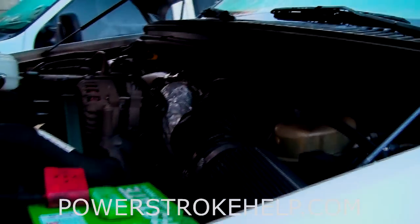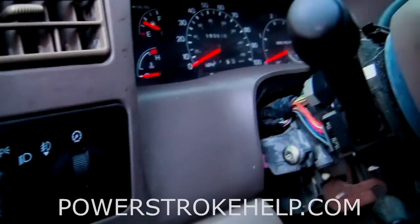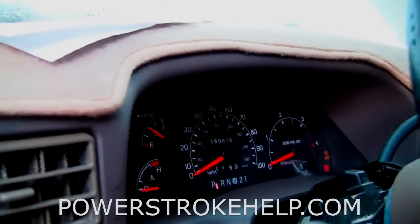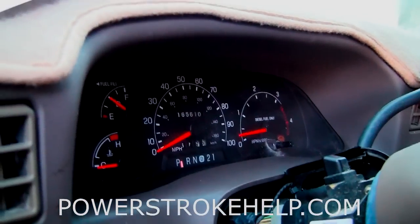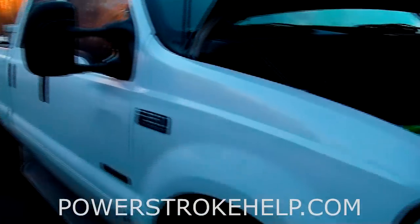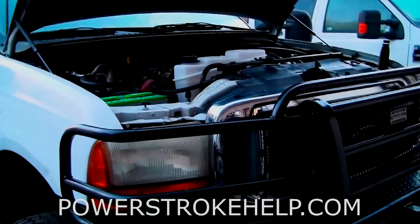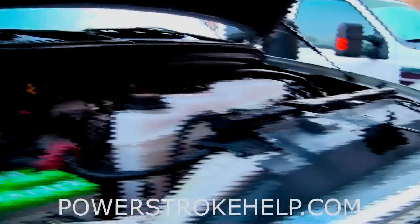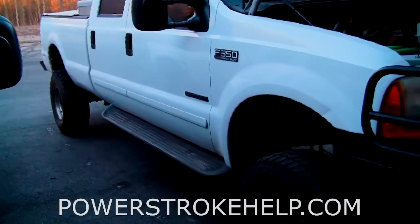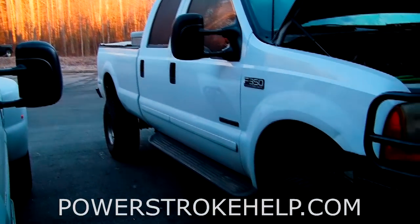So now I have no break in this film — make sure you see that there are no edits here, I'm not playing games trying to edit in the motor after we've started. So now here we go, we're going to start it. Rekey the glow plugs here. Now that's pretty good right there. It's right up. No smoke. That's only after driving this truck 30 miles — about 31 miles. We did find a clog in the fuel tank and checked the fuel pressure to make sure it's okay. That's the only repair we did. Not even a little bit of smoke. That's pretty amazing.